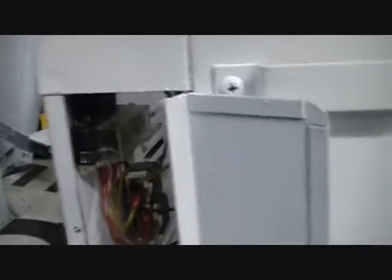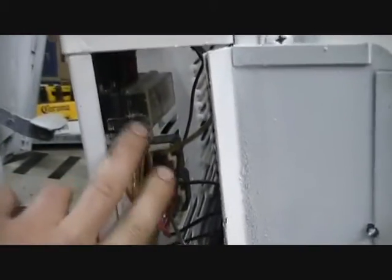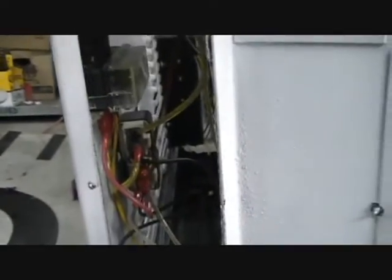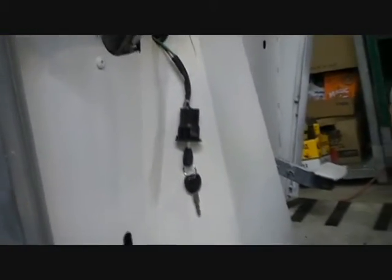I haven't figured out the final placement of the box until I figure out the floor. So here's where I've decided to put a fuse panel — this is my 12-volt fuse panel. We've got a couple of relays there. Now I've got some fuses inside this fuse panel that are hot at all times, namely the brake, horn, that sort of thing. And I think the dome light's going to be off of that too. And then I've got some of these that are triggered from a relay, which is triggered from the ignition key, which is right there — I've been wiring so it's not in its hole right now.